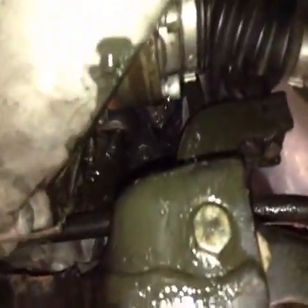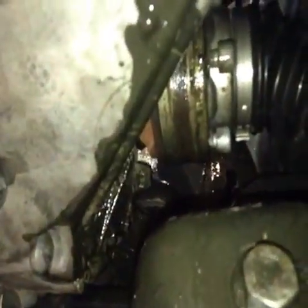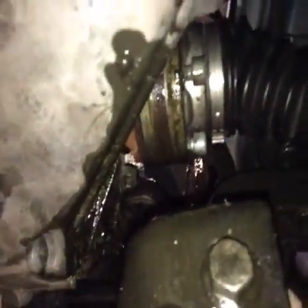They're not loose. So what I would recommend is removing the drive axle and repacking the boot with fresh grease. As you can see, there's quite a bit of grease being thrown and slung around, so we don't really know the integrity or the amount of grease that's left in it. And then repairing the threads in the drive flange at the transmission if needed.